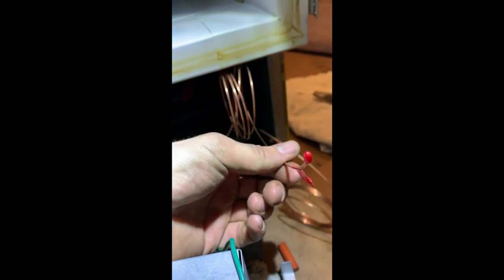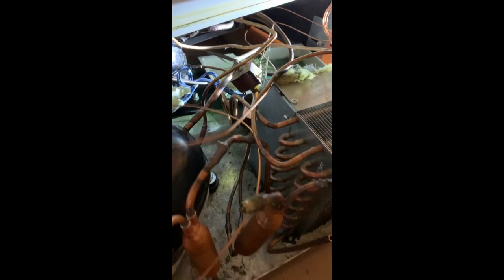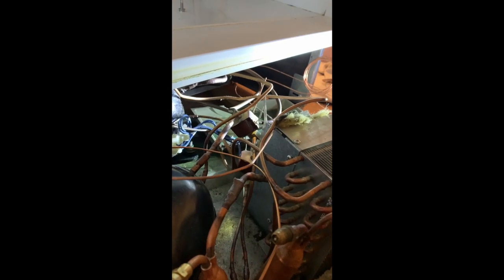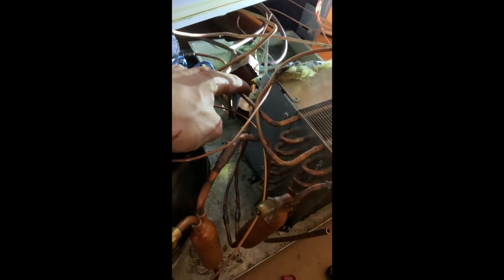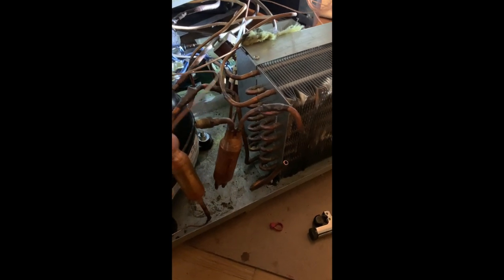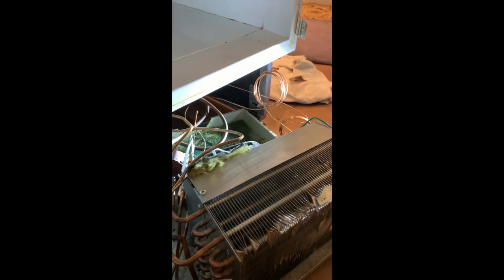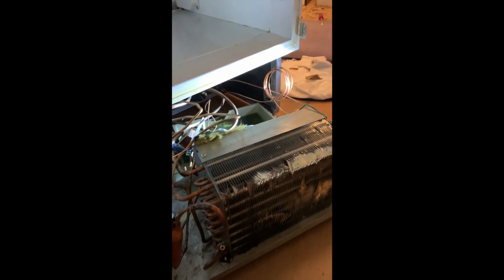We are changing the filter as well as both valves. The capillaries are already cut — it will simply pop out of place if we remove each screw on the condenser, one and two. Then we take this out, mimic it, and change all the copper connections, all the valves, and the filter all at once. Then we'll simply solder it back into place into the condenser and get the capillaries into the back side.